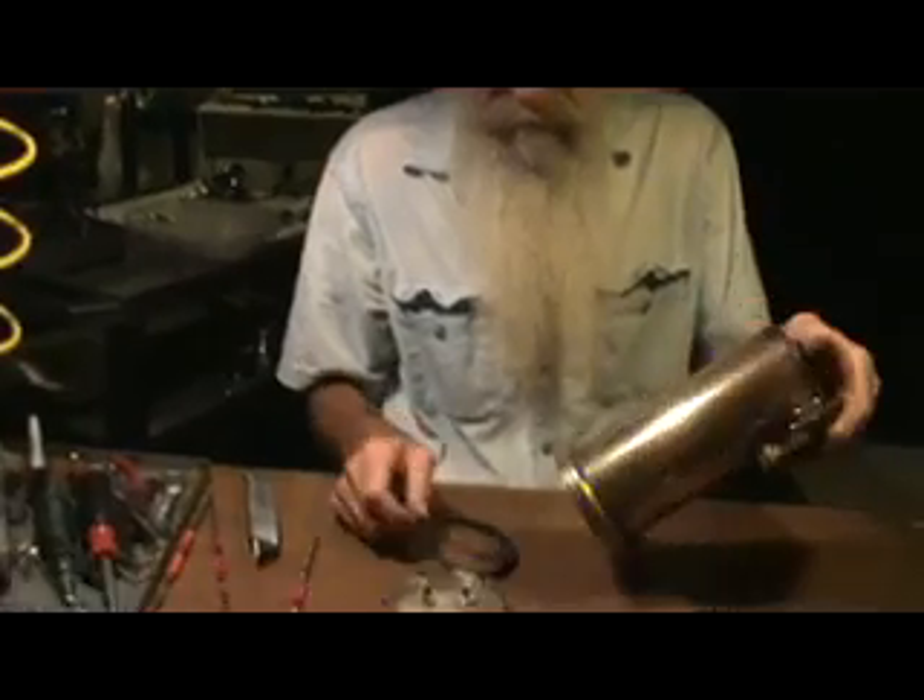You can also solder or braze these, but then what you end up with is a boiler with a whole bunch of warts all over it. It can be done that way, but it's more invasive. Using this lock seal fixes the pinholes every time. And as I said, no pinholes here — but that is more common than you would think. You find the little white dot, little puff of scale on the outside, just remove the scale, put your lock seal on it, and it's fixed.